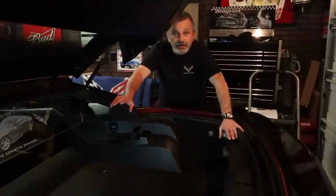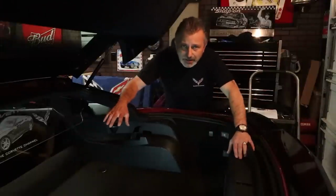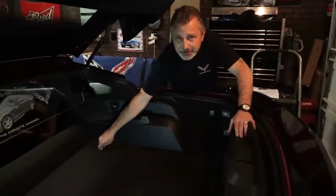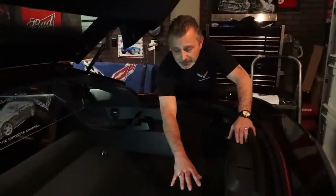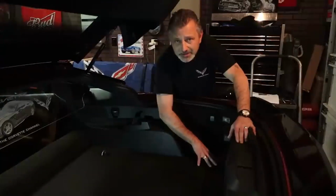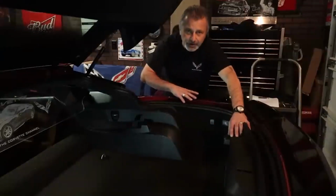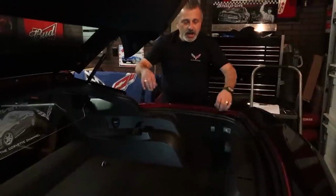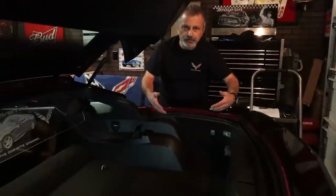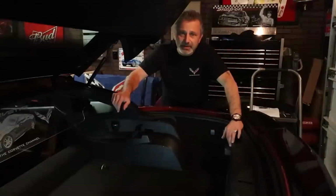Okay, before we get started here in the trunk area, I just wanted to cover something that isn't in the instructions, but I just wanted to point it out. Better be safe than sorry. You're going to be leaning into the car a lot. You're going to be working over here, removing this D-ring in a second, and then we're going to be pulling this carpet back, and we're going to be looking in the computer area that's right underneath my hand, right underneath where the battery's at. So you're going to be back and forth, and you want to make sure that you don't get any scratches on your fender. What I did is I removed my belt and I pulled my shirt out to cover everything here. But you can also use a fender cover or something like that, or a towel. I just wanted to cover that ahead of time so we don't end up with any accidental scratches.